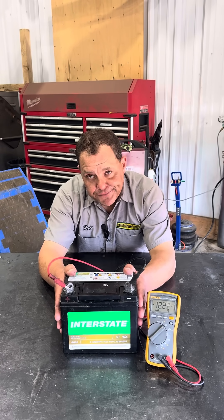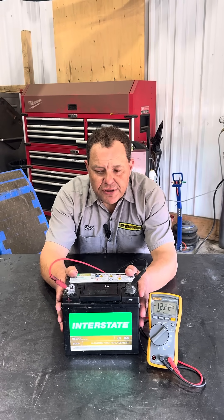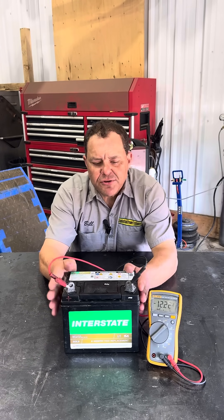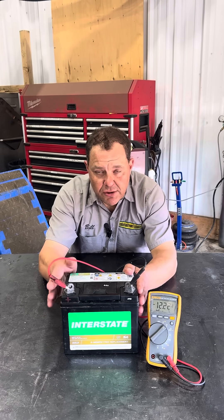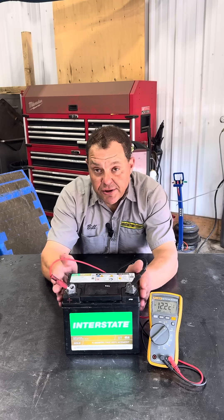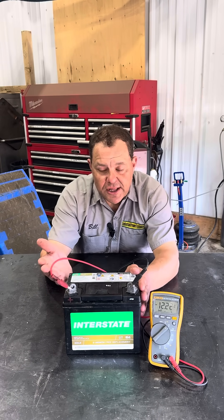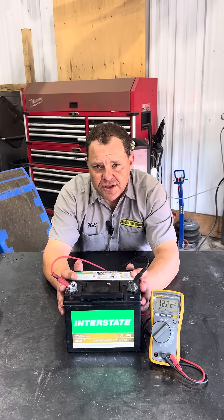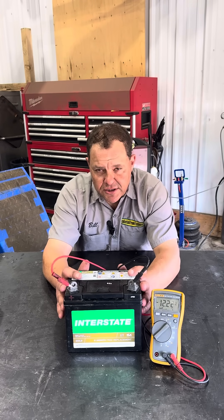Now the customer has a bad battery and a repair bill. When it was still hooked up — he never disconnected it during all of this — once fully charged and he went to start it, it damaged the diode in his wiring harness. There are other things this could damage too, including electronics.